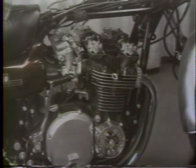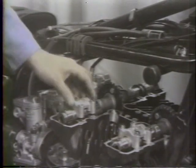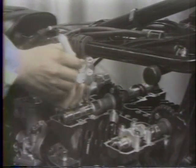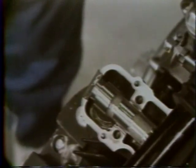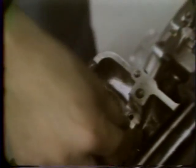Each camshaft is held in place by two caps. The caps in the cylinder head are protected from wear by using split Babbitt metal bushings. If these bushings become too worn, the camshafts will become noisy, valve timing will change, and there will be a loss of compression at higher engine speeds. To measure wear, unbolt the camshaft, insert a plastic gauge between each lower bushing and the shaft, and bolt the shaft back down with a specified torque.